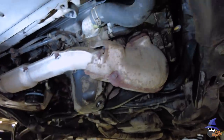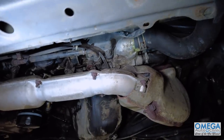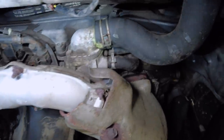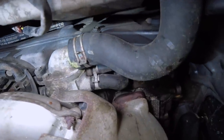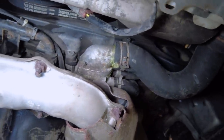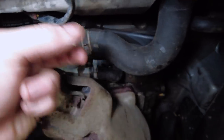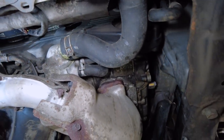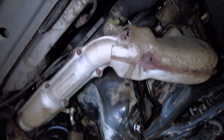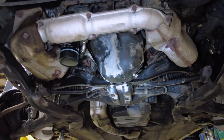You can see a little bit of crusty antifreeze residue going on there. It's not leaking, but what can happen is the aluminum can actually start electrolysis and get pinholes in it. With this situation, if it's not leaking, you just leave it alone — if it does start leaking, they're going to get a new hose and a new water neck, a thermostat cover there. Here's our oil pan — everything's nice and dry. And here are the oil leaks we talked about coming from a couple of different places.